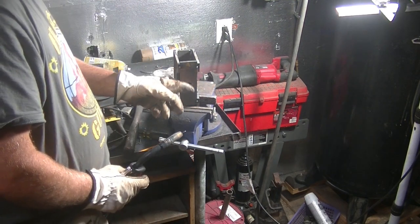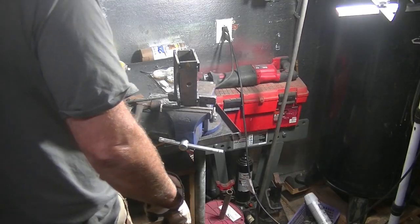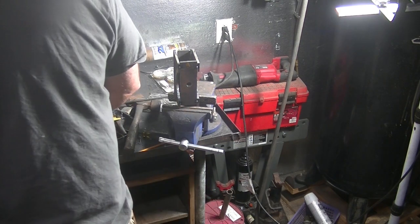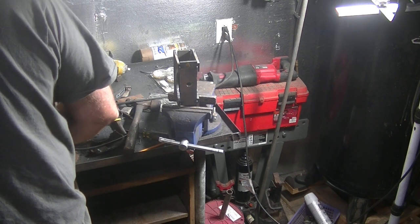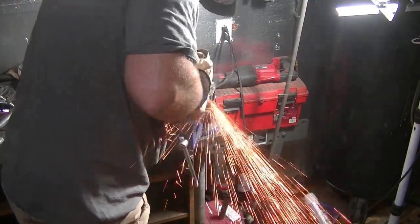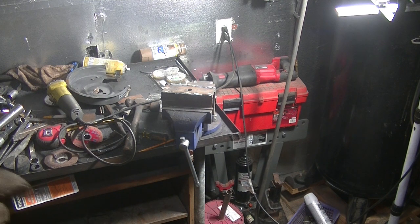This plate here on top is for the other piece — I just put it in there to hold the distance while I welded this up. I'll find something to grab it with so I can put it in the vise and grind that top off. The next one I'll bevel it before I even start to weld it, then there won't be the groove in it.